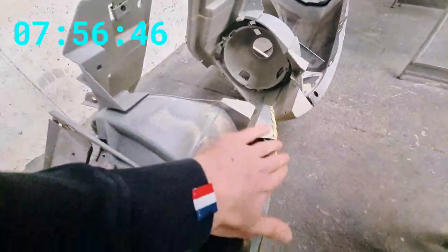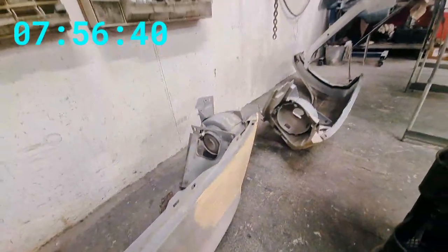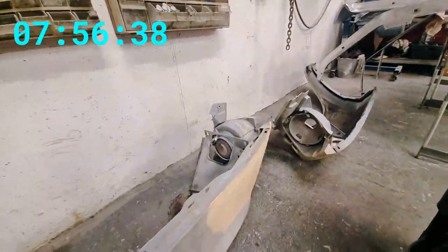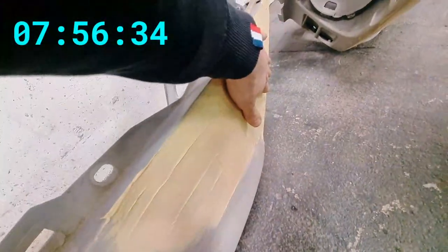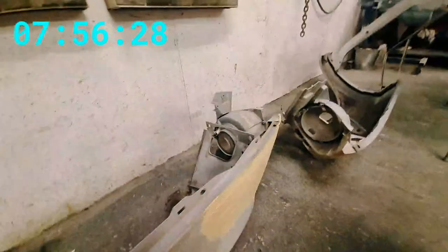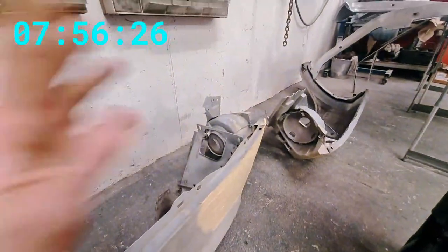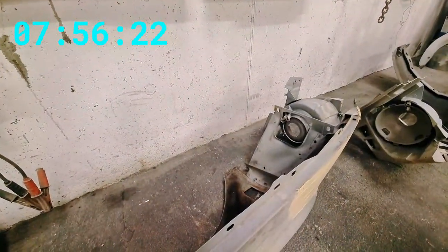So the headlights have been left on, and we've made it hold with bolts because we're going to sand it. There's been a bit of filler put on from the factory in the 60s and 70s. Ford Mustangs were never straight. It's a common thing, and I want to make the car really straight. So this is all getting removed down to a very, very thin layer to have a little bit of alignment, so it will really flow along it. All those parts are getting removed.